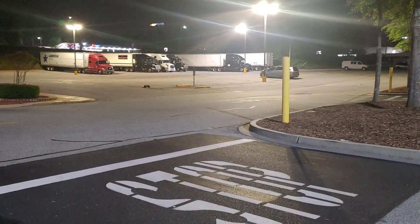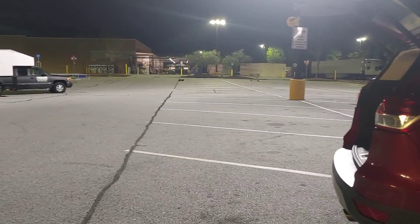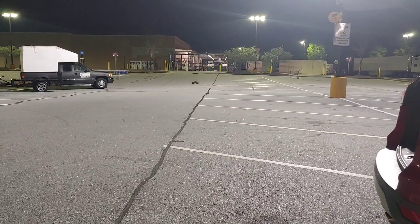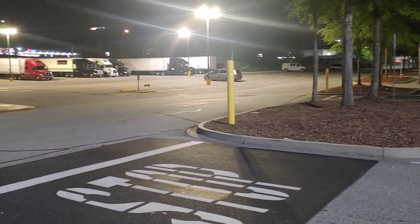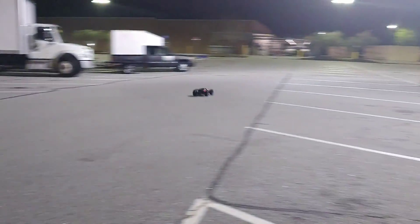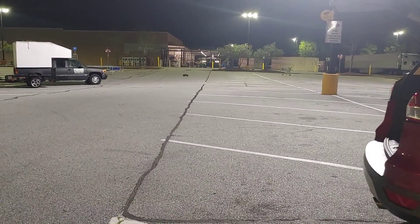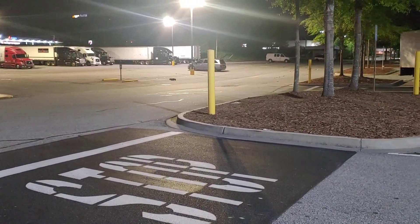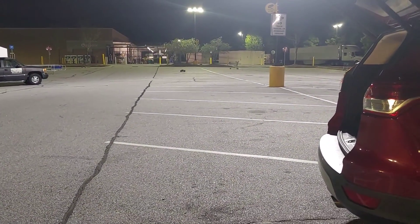I could do laps like this and I'm going to until this battery dumps — I'm running a 4000mAh in here. Right there is where I really want that faster, stronger servo. I know this servo can do 7.4 volts, but the speed controller is not capable of 7.4 volts, nor is the receiver, so it kind of beats the point of having that unless they knew you were going to upgrade it.